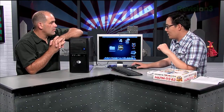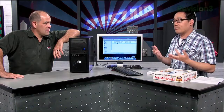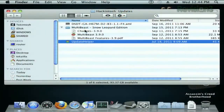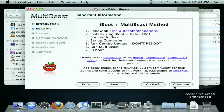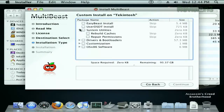After you install OS X, you need a couple of things. One is the update helper, which you can get from TonyMac x86 — it gives you a link to essentially a service pack update for OS X. You do the service pack update first, then reboot, and then you go into what they call MultiBeast. MultiBeast installs the bootloader and allows you to select the various drivers, network support, and other aspects for your machine. The best way to do that is with the DSDT — a script that preloads all the various aspects for your motherboard and hardware. TonyMac carries these as well; users put them together for specific board configurations.